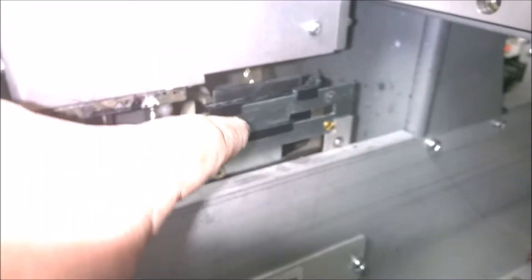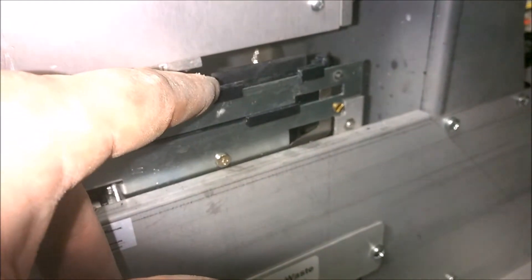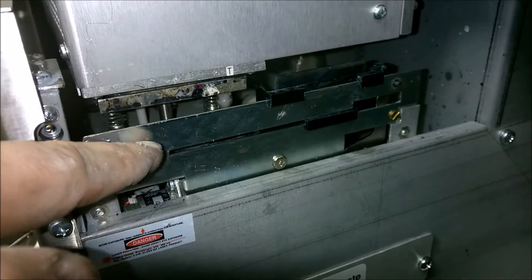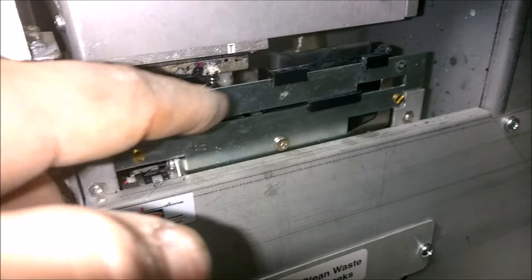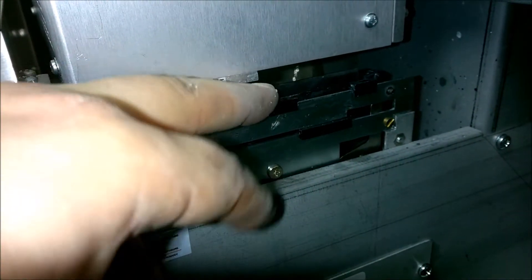After I started cleaning it, I realized that the wiper system wasn't moving back and forth — it basically just stayed in place and made a weird noise. When I told it to do a wipe on the heads, I could touch it and move it, and it would go back after it was done, but it would not go the other way. So I determined that the wiper system was all gunked up with ink.